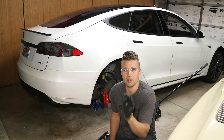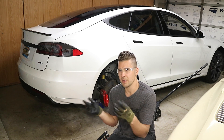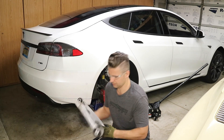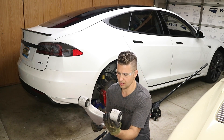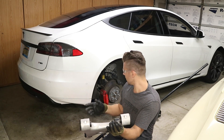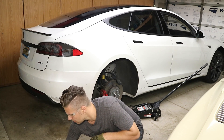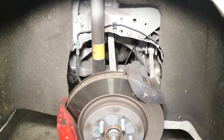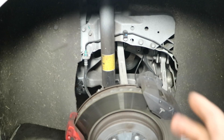I think I'll start off by undoing the lower control arm first, because I don't think it's the upper — it might be the lower that got bent. It's pretty hefty, but we'll give it a try. We'll undo the lower control arm and see if the suspension shifts at all. If not, I'll keep going and take everything apart until I figure out what's going on. Looking straight at the suspension, you can see how the control arm is sitting angled instead of nice and straight — everything has shifted forward about half an inch.